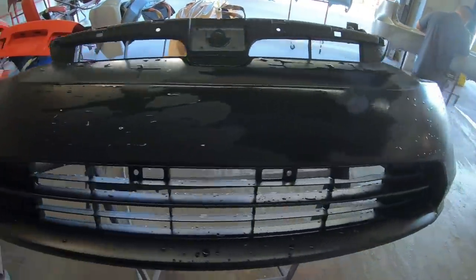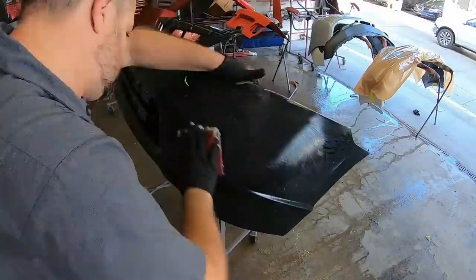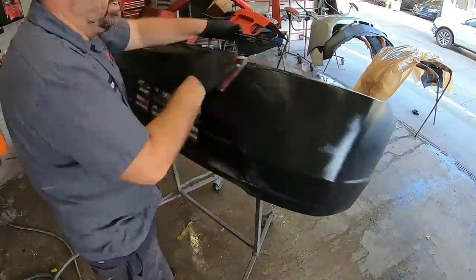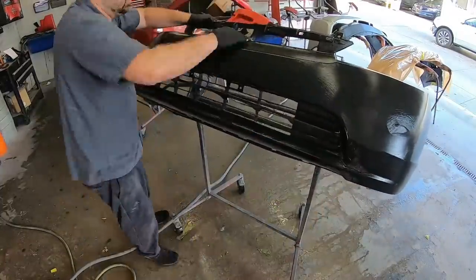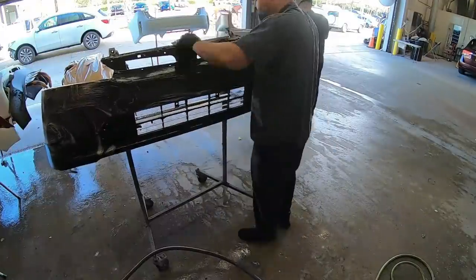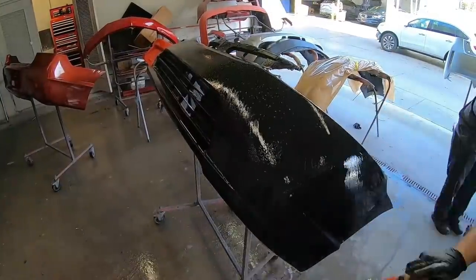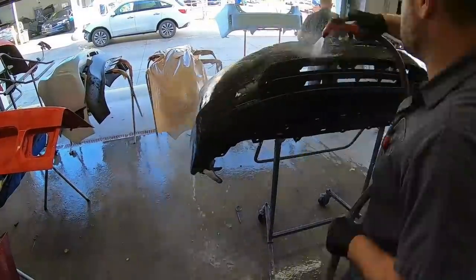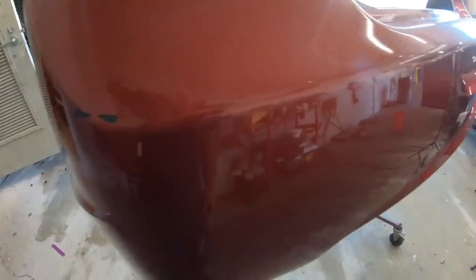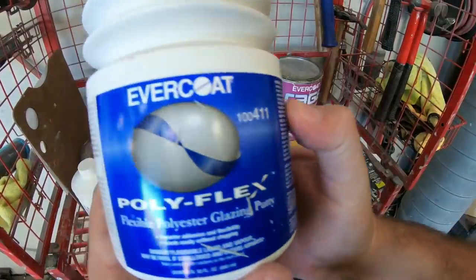When preparing new parts like this OEM bumper, we're going to be using a scuffing paste and a maroon scuff pad. A maroon scuff pad is equivalent to around 400 grit, and that scuffing paste has abrasives and cleaning agents in it. Make sure to get it all nice and scuffed up — these Honda primers are a little bit hard to scuff, you'll notice they don't completely dull out, but they are a very hard and good primer. Wash it all off, let it dry, and it's good to go. On the rear bumper we have a scratch and some normal everyday damage, and we're going to take it down with 180 on that scratch.